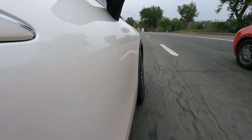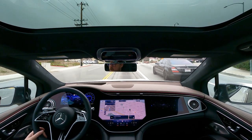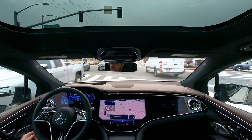If there's one significant dynamic drawback to the EQS SUV, it would have to be the brakes. The regenerative braking system is very good, and Mercedes lets you choose between three different levels of regen, including an intelligent mode where the car decides what's best for the situation, or a fully-on one-pedal driving mode. The issue is that when the car is in regen, the brake pedal itself actually moves closer to the firewall, which feels very unnatural if you move your foot over to engage the friction brakes. Luckily, you can avoid the issue altogether by using the one-pedal driving function effectively.